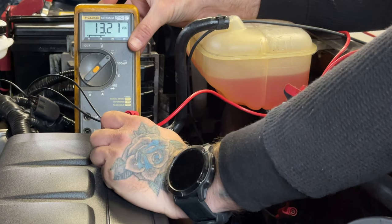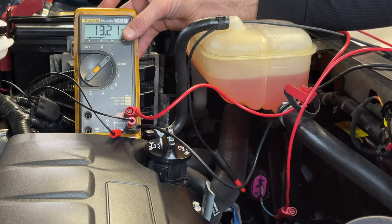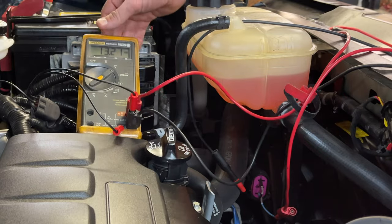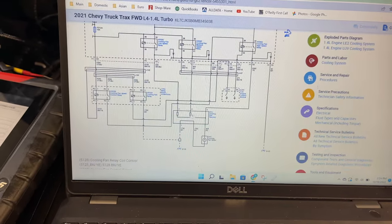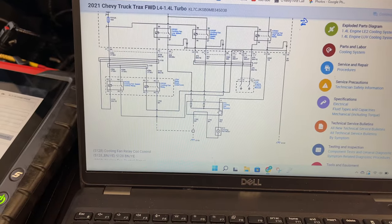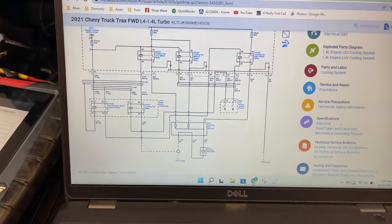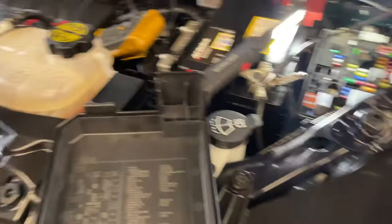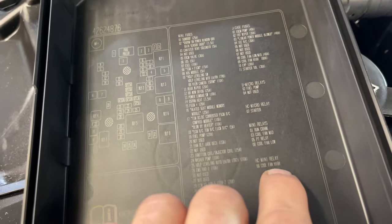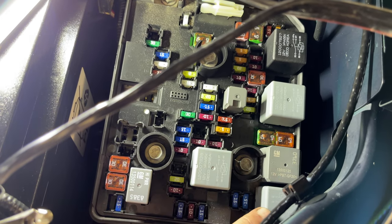That's why you load test your circuits. So now I'm going to figure out where my voltage drop is happening — where I'm losing my power when I load it. I've got a diagram pulled up here and the high speed relay is the one supplying pin number four, the one having the voltage drop issue. There are no connectors or anything in between — straight out of the fuse box from the relay and the fuse. Looking at the fuse box, that's relay six — which is an odd relay compared to the others in the box.